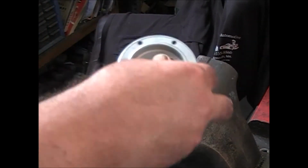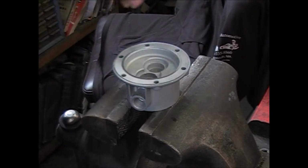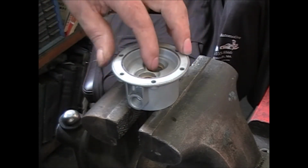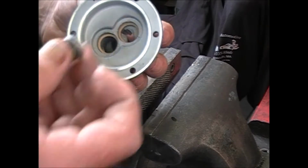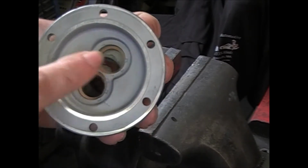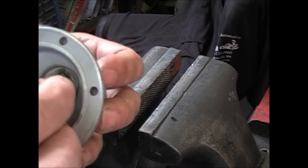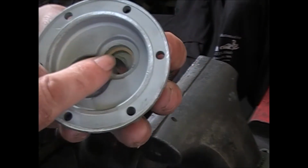Now for the valves. You're going to take a gasket, put 1 gasket in each hole. Sit it down against the casting. Now in the event that you forgot how these valves went, whether it went this way or this way, just look down inside. See that piece of casting right there? If you happen to put this down, it would hit that and not seat right. So you're going to set it with the rivet up.